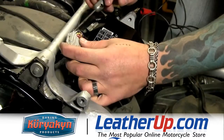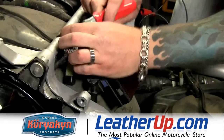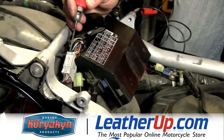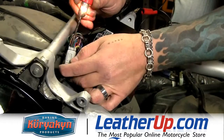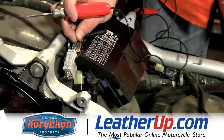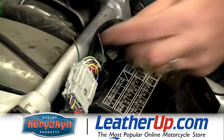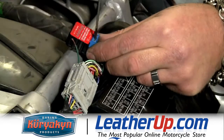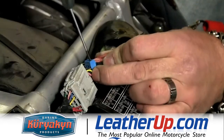You're going to want to use a test light so you can check your wiring. You're going to want to find the brake wire that supplies all the rest of the back of the bike with your brake signal. There's our brake wire. We're going to have the incoming side from the bike into the incoming side of the module and our brake power going out.